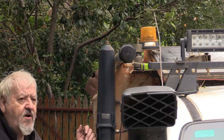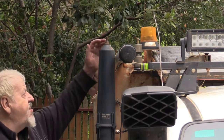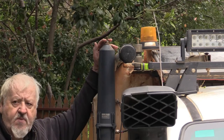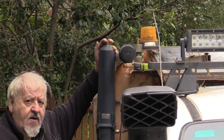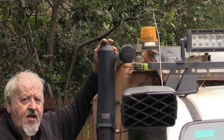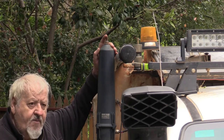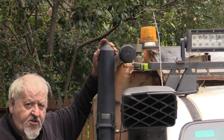The problem with the auto-tuner is I want it up as high as possible for best performance. The HF aerial on here is about 2.8 metres of stainless steel whip. You're already two metres off the ground, so sticking another 2.8 metres above that will hit power lines and potentially kill you. I don't have that antenna up when I'm in the city or in the mountains — I use it out in the desert, because the old rule with antennas is height is might: the higher it gets, the better it is.